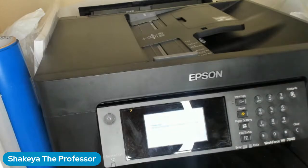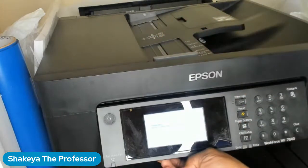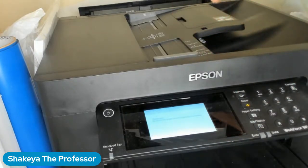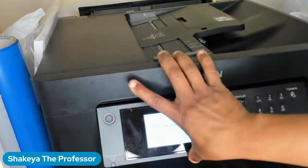How do I clean the wheels? I take a disinfectant wipe, like a Lysol or Clorox wipe. Open this up, put it through the back — through that same well I put the paper towel in. Grab a weeding tool to help pull it out through the front and go back and forth. Or you can tape a gift card — or if you have a sublimation business card, tape that to a ribbon, soak the ribbon in alcohol, push it through, and then pull it back and forth through the back and front. That's how you clean the wheels.